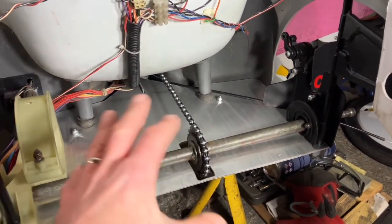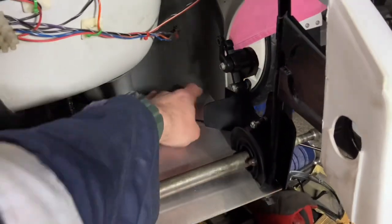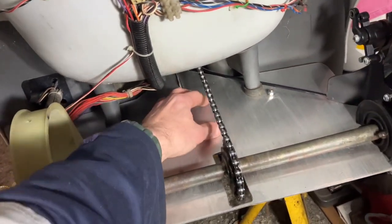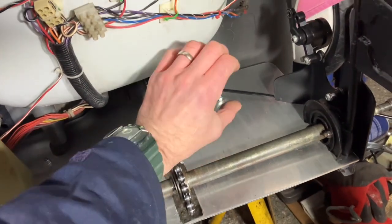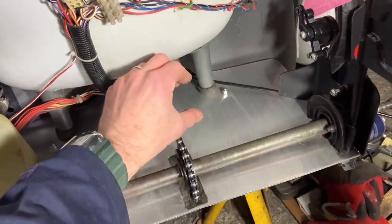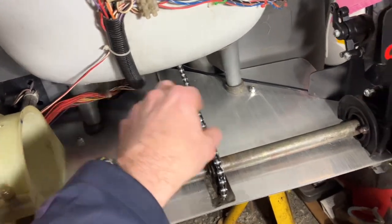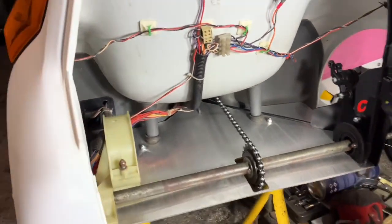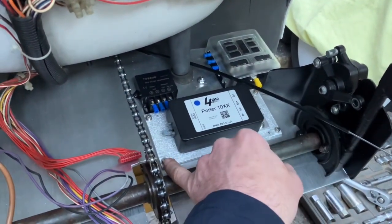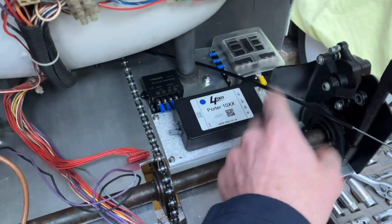After the motor is in, I'll check it on 12 volts first to make sure the axle is straight and smooth and not causing any issues, just in case the new plate has rejigged something. All the wiring is still there — I may need to remove it but I'll leave it for now. Next job is to install the motor and test it, then start mounting the electronics. I've got extra capacity here and here — thinking of mounting the controller somewhere it stays upright for heat dissipation, plus the fuse box and a step-down converter. I've ordered nylock nuts and M4 allen-key-headed bolts so it all looks absolutely sweet.